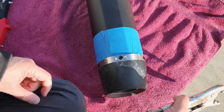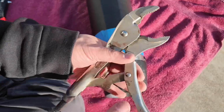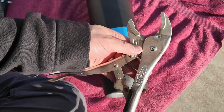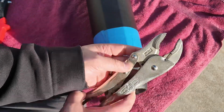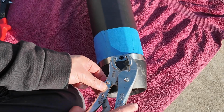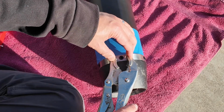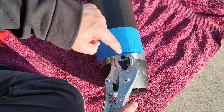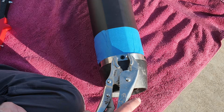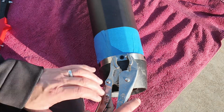So what'll help you as you do the last two, these last connecting rivets will stay apart. I did get myself a wrench here. I forget what kind of wrench you call this, but I set it up because there are 2 tabs here that you can use to grab to pull in this clamp. And so I just set it up where I pulled it in and locked it in place, and then I used the rivet gun to apply the last rivet. And that way I made sure it was tight, the band was tight against the side of the carbon fiber exhaust.